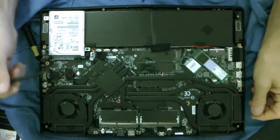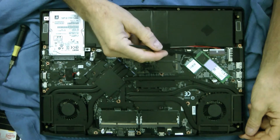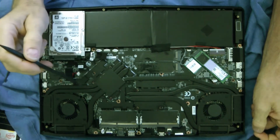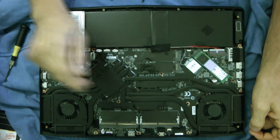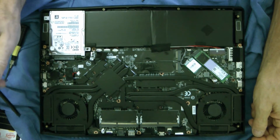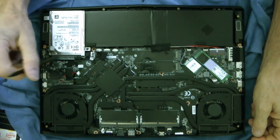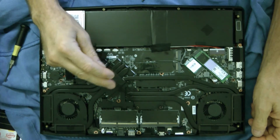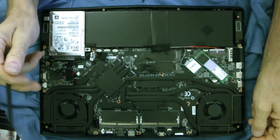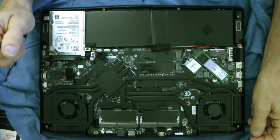So you get into the bottom of the computer and we can look at it. We see we have your M.2 type slot here. You have your wireless LAN. You have your extra memory sticks there. It already has 16 gigabytes installed, and that's probably on the other side, those 2 8s. So put another 2 8s in there and you could have 32. Or I think you could put 2 16s in here and you get like 48 or something, or whatever, you want to do the math.